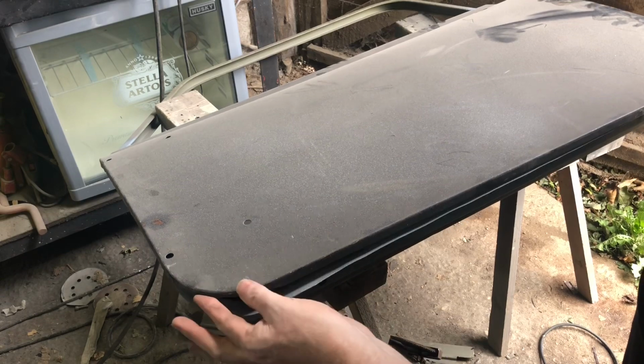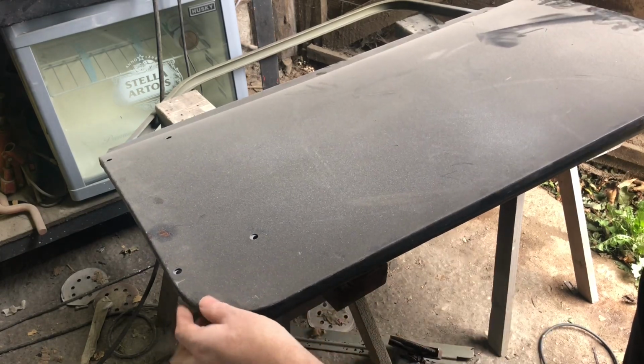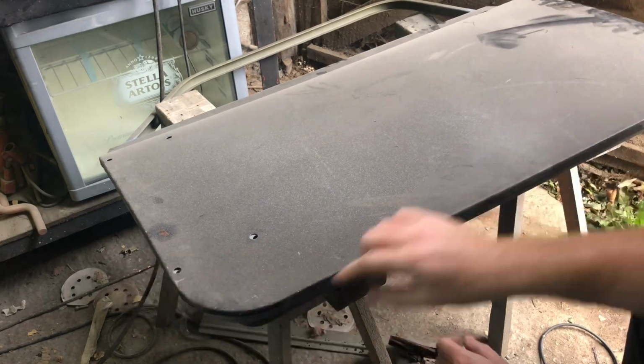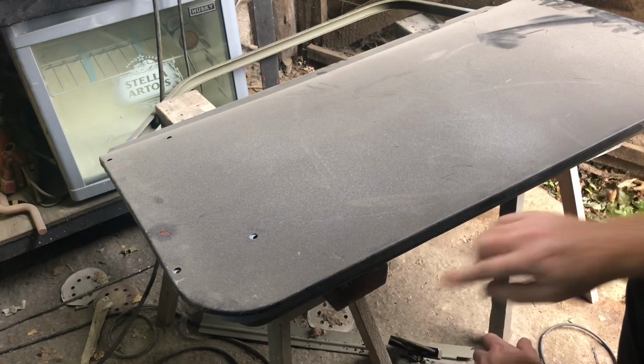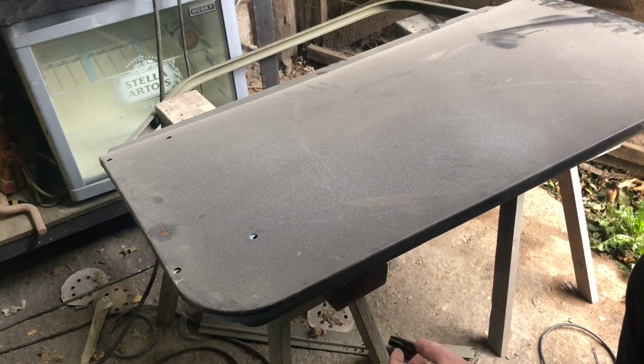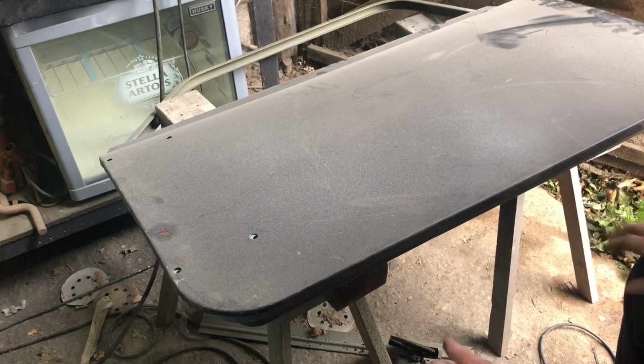This panel, and move the door skin up a bit, and actually that fits the door better, and it gives you a few more millimeters clearance at the bottom, because it's normally very tight. Where they're normally very tight on cars is along here and along the doorstep. But anyway, yeah, looks like it's had a bit of overspray on there. But we'll come over all of that with the DA once the door skin's on.